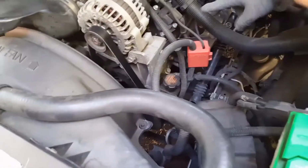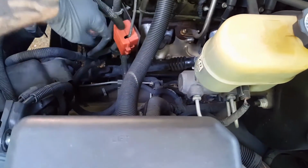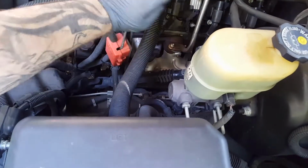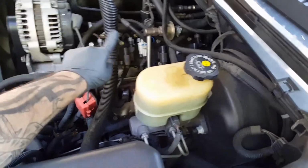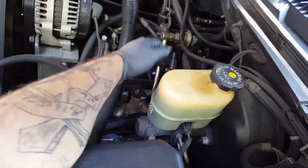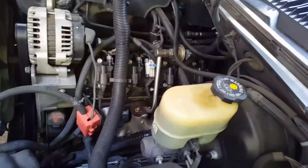I mean, if you look at the intake manifold or the, whatever, it's been a long day. Sorry, guys. This is the head. Valve cover. Okay, when you look at the valve cover, it looks like an LS under this plastic thing. Looks like an LS truck intake manifold. So I'm gonna guess this thing has probably an LS1 is what I would say it is. It's an iron block, aluminum head.